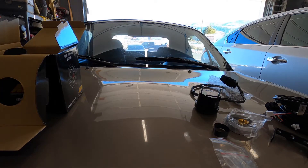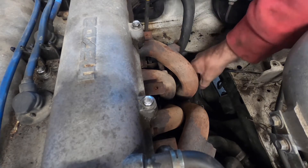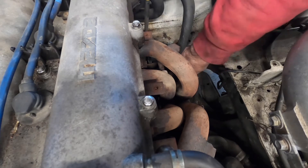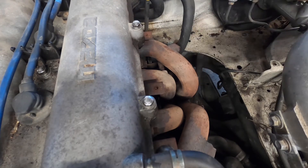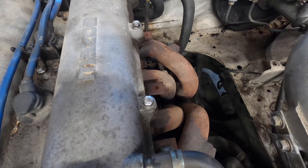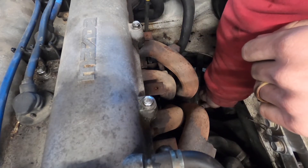What I'm going to do is clip the O2 sensor wire because I'm going to need to tap into it anyway, and then I'm going to slide the box end over and use a red connector. I've watched a couple of videos and read through the manual to decide what to do next. I really can't see anything either — it's quite dark under here.